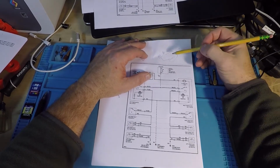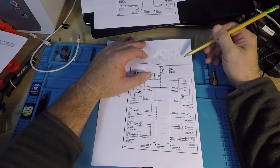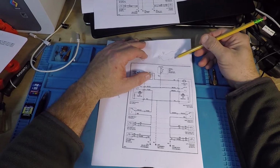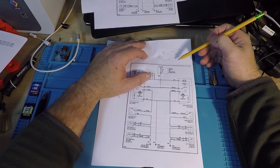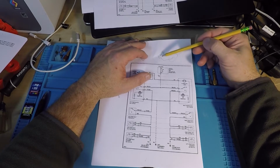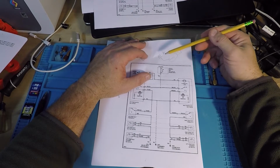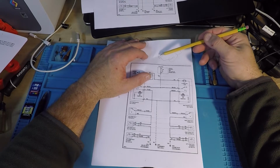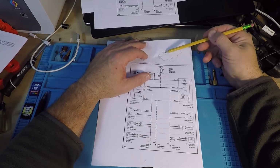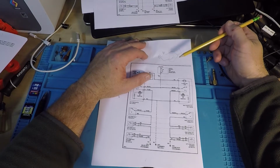That's it. Now, if you take battery positive and short it to battery negative, that's a dead short. So you need a measured load in the circuit to help control the flow of current and how much current. Just take a jumper cable if you want. No, I'm not being serious. If you short across the battery, what's it do? A big arc and spark. But if you take a small light bulb, a turn signal bulb or something like that, and you connect it from battery plus to negative, that light bulb is in itself a load. It regulates the amount of current.